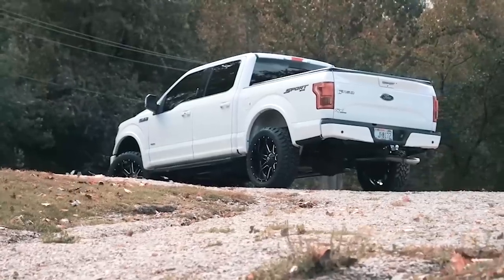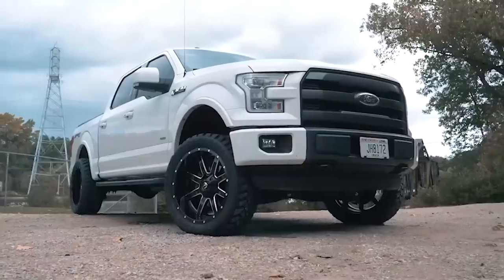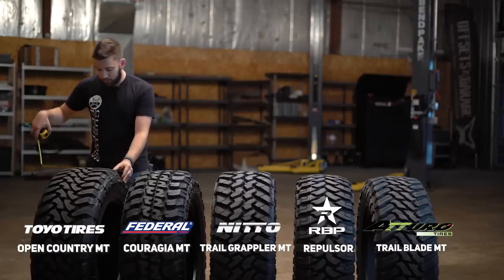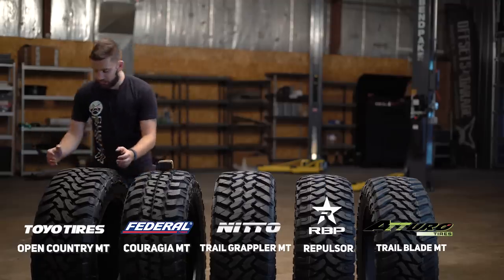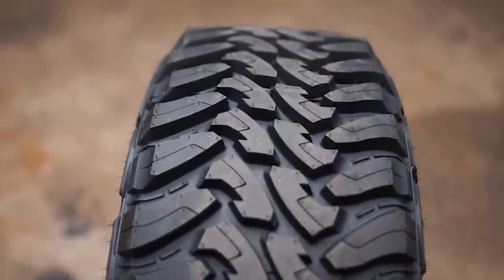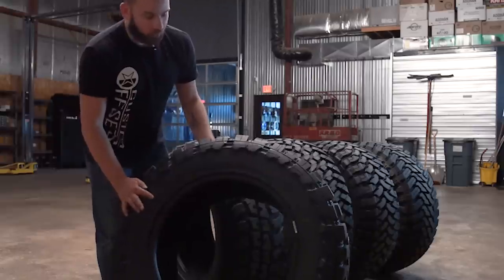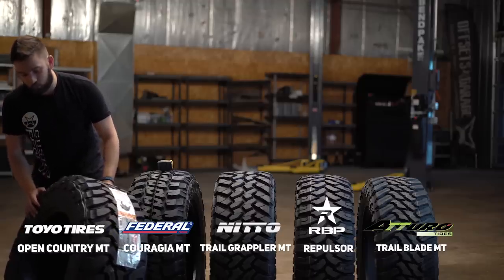Same as the Nittos, you can expect a lot of mileage out of these for a mud tire — not uncommon to see at least 40,000 miles. If you need more mileage, step down to a hybrid tire or RT tire. True measurements are kind of the same — 12¼ to 12½ — same as you'd see on the Nittos. Design-wise, it's a mud tire with big angular shoulder blocks, and these guys have a ton of hooks and angles on the center section that set them apart. As far as sidewall goes, it's a nice aggressive sidewall with design elements — angular with a Z-cut into it, giving it a nice rolling appearance.